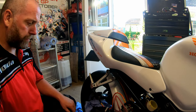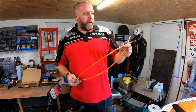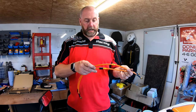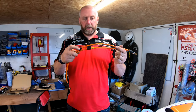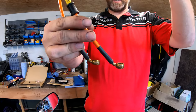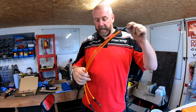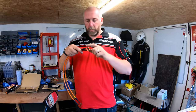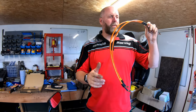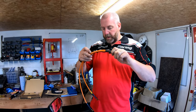We'll do the filling of the system and bleeding all at the end - we'll get the front lines installed first. Here are the two front lines, which are considerably longer than the one used on the rear. We've got the two little bushes that the brackets go around that we removed earlier, and we'll be reinstalling those. At one end we've got kinked banjos that go off at a 45 degree angle, and at the other end we've got straight ones. The straight ones are going to go at the master cylinder end and the kinked ones at the caliper end. Once we get the caliper end on, you'll see why - because it kicks the hose out away from the caliper, up the fork, up to the master cylinder.